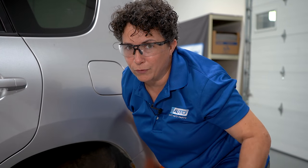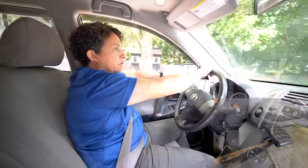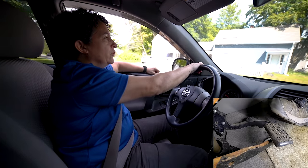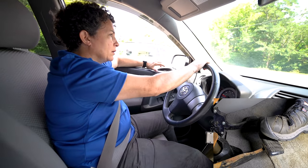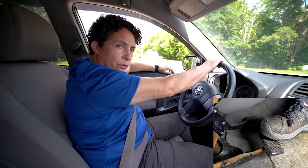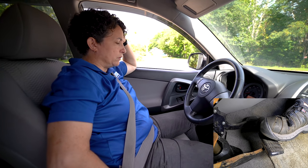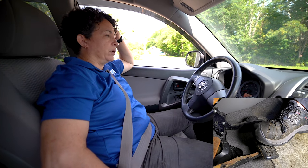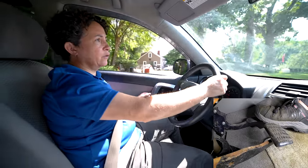Don't forget to torque your wheels before you go for that road test. So we're outside going to road test this — the brake pedal feels great. Driving down the road, coming up to a stop sign. I'm going to check and confirm there's no air in the system by applying the brake and making a mental note of where it holds. That pedal is not traveling. If the pedal was slowly sinking down under pressure, that would mean there's air in the system — but that brake pedal is not doing that. I'm going to do a kind of panic stop — but there's a cop right here, so I won't lose my mind.